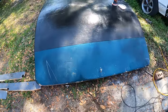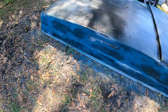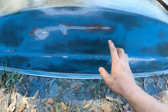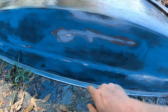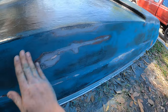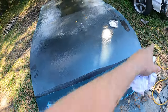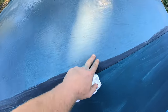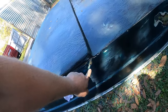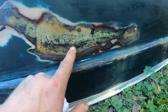Alright, I've sanded it and uncovered all the spots I was worried about. This side is pretty beat up, and that hole we saw earlier — got this uncovered, whatever that was. You can see there's bondo from previously — they used car auto body bondo instead of glass bondo. This side the spot got cleaned up. I've already sanded everything and wiped from this corner around to that back corner with acetone. Got those spots uncovered, some stress cracks in there, and this big eating spot from the tire — I believe that's still rubber stuck in there I'm trying to get out.